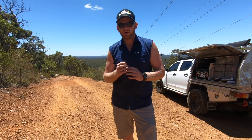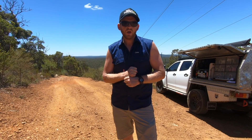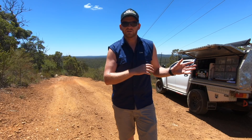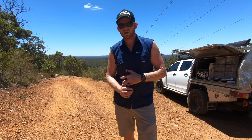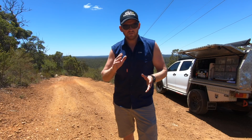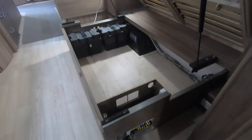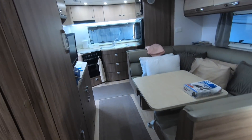I also had to fit a new fuse box, because previously everything was fused through that all-in-one charger — it was an AC charger, DC charger and fuse block combined. So new fuse box, and I've also wired in an isolator so that when he gets home and parks the caravan up in the shed on a float charge, he can switch everything off so there's nothing running off those batteries.